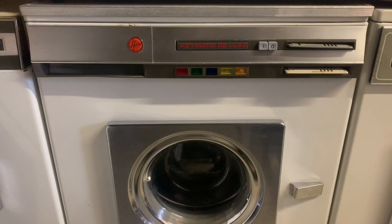This is the Matchbox Hoover Keymatic Deluxe Model 3243H — my favourite of all the Keymatics. Many components have been replaced over time: the timer and keyplate reader have been upgraded for ones from a later Keymatic, and the inner drum is not original. The outer drum also had to be replaced as the original was totally rotted out. Originally it would have had white and grey keyplates, but it now uses pale honey and orange keyplates from the A3062. This Keymatic and later ones have electric indicator lights controlled by a disc on the end of the timer — less and less mechanics as time moves on.